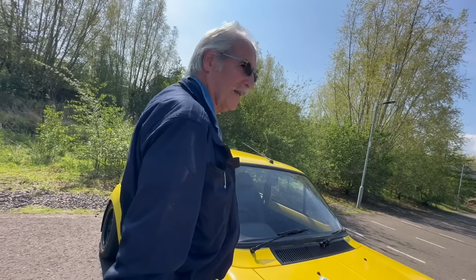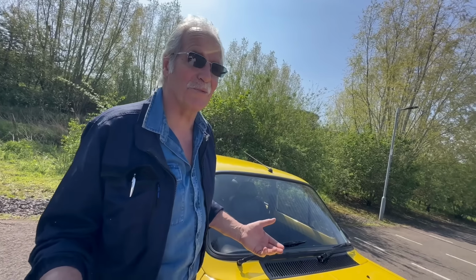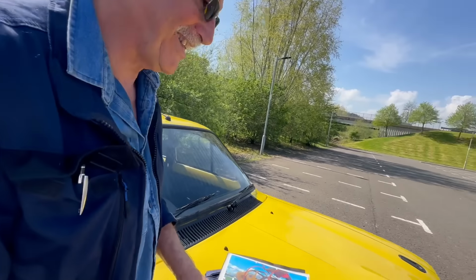Again, it was just a mate of mine who had a couple of old Escorts lying around, and the roofs were fine. Just went along and chopped one off. Yeah, the roofs are only buggered because they're a vinyl roof. Is that what holds the moisture in? Yeah, it does, aye. And it goes for the gutters. They start to rot inside the gutters. But normal roofs, it's about the only place that's actually safe in a Mark 1 is the roof. The rest are dodgy, to say the least.